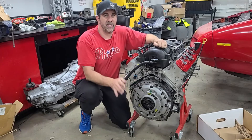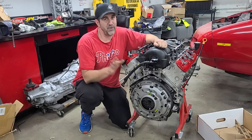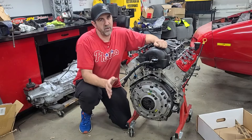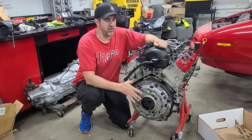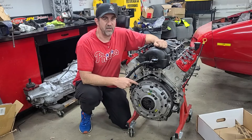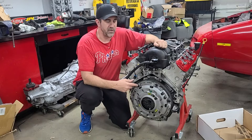Installing a new clutch kit on your engine is pretty easy. Just make sure that you have it torqued down correctly — don't overdo it and make sure that it's all aligned. It's really easy to do when it's out of the car, a little more difficult when it's in there. But if you have a rear wheel drive car, when you take the transmission out there'll be a lot of room. Front wheel drive would be a little bit different, but there's always a little extra room because the big transmission is not there, so you normally have pretty free access to it. Now on the LS1, a lot of people will say 52 foot pounds on these, but GM spec is 22 foot pounds. A lot of people have broken these bolts trying to torque them down to 52 foot pounds. So snug them up, check them to 22, and they should be good to go.